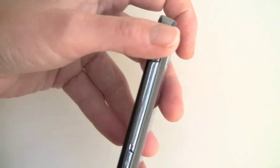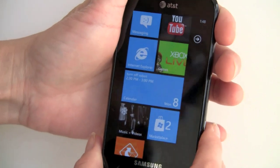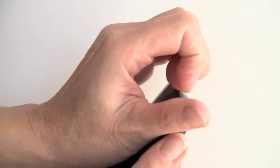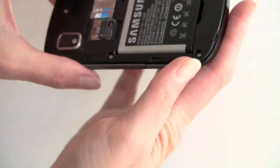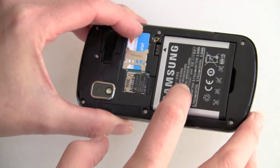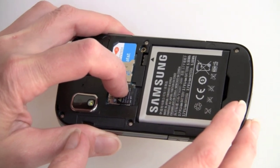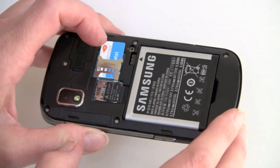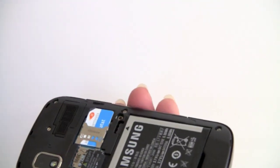The Focus is a little different from other Windows phones in that you can actually expand storage. When you get the phone, it has 8 gigs of built-in memory and there's a micro SD card slot. So you pull off the phone back and here we've got the SIM card slot, the 1500mAh battery, and the micro SD card slot. There is no card pre-installed, and instructions on the back say to install your card first — the quick start will tell you how, because you have to press the volume down, the camera button, and the power button to boot up and format the card.